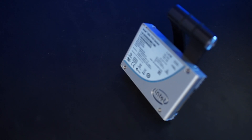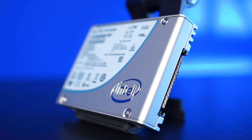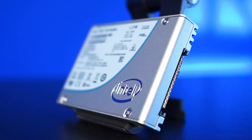As you'll notice, we actually have two different kinds with us here today. The first one is actually in the shape, mostly, of a regular two and a half inch drive, but the connector — that baby is anything but regular. It uses an SFF8639 connector, which is a type of SAS connector normally reserved for enterprise-level applications. This drive completely bypasses SATA Express, because even that format wasn't fast enough for it.